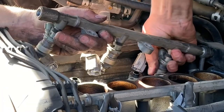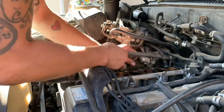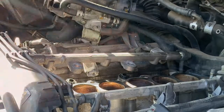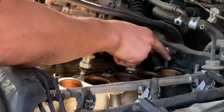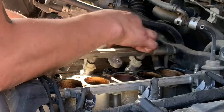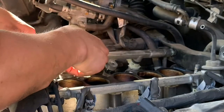Before putting the new injectors in, yanking out these old injectors. Put the new injectors in. When I'm trying to put this fuel rail back in I'm putting it in at an angle instead of dropping it straight in - that's going to be a big mistake. If you stick to the end you'll see why. The injectors didn't drop straight down because I had some resistance on that back banjo bolt.